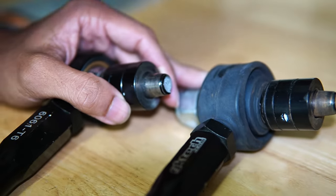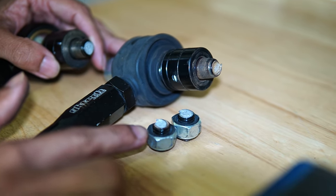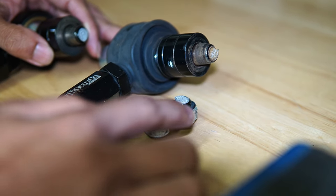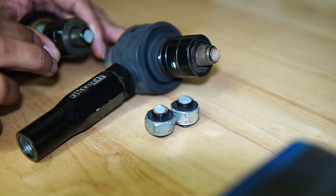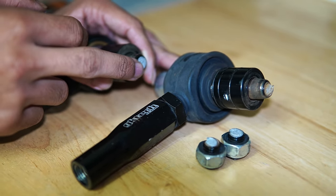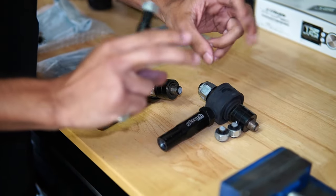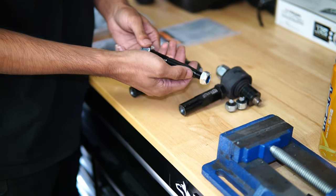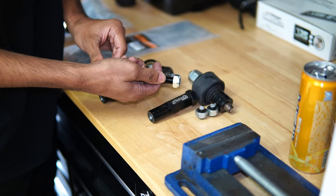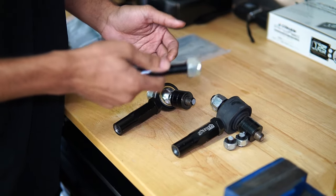And you could see on the opposing side where the nuts are, the casting for the shank wasn't the best, with a lot of pits and stuff, so I'm guessing there was a lot of air in the casting, which made this a real weak point, which is why they snap here. For the upgraded shanks, I'm not sure if they improved upon this area, but we could try at a later date, but not right now.